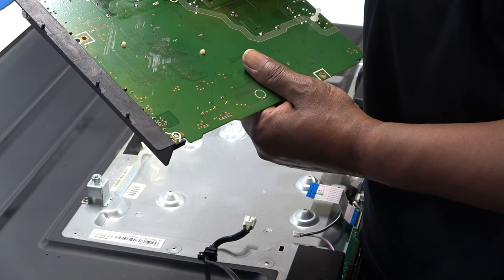Okay. And here's our other swollen capacitor right here. Okay, when it does that, that is definitely bad. So that is our deal killer right here, pretty much. So we'll just replace them both, okay, because the other one's on the way out. Now here is a good capacitor right here. Cool, that's the swap from a donor board. So let's check this one out and see what we get. That should be close to 10. Maybe 9 or 11. Yep, 10 microfarads. And where's my other one?